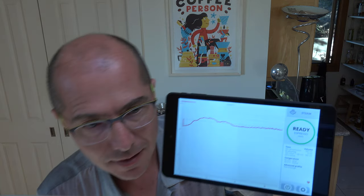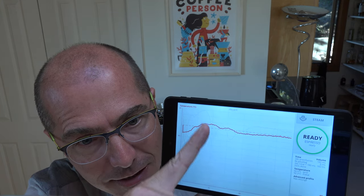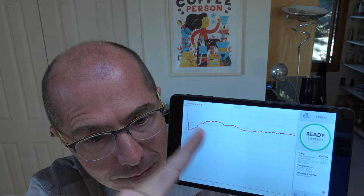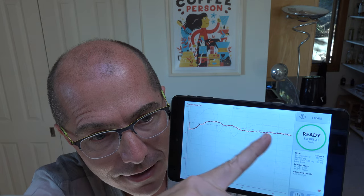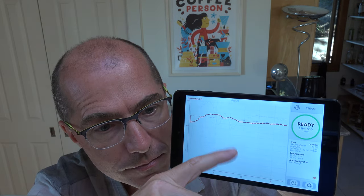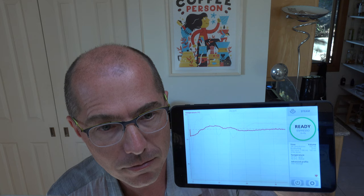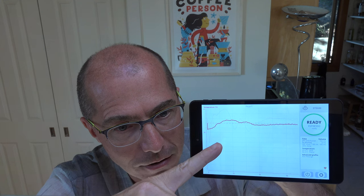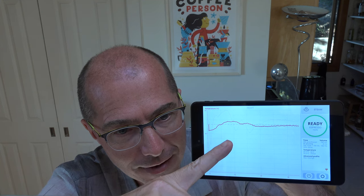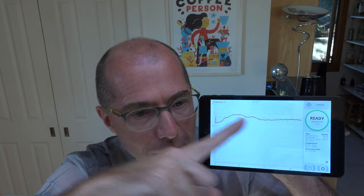Okay, I don't think you'll be able to see this here. If I change the brightness, it'll clear the chart. There we go. Can you see the thin line? You can see the thin line does adjust. It goes about 2 Celsius up from our goal temperature at about 10 seconds, and then from 10 seconds on, it's oscillating within 1 Celsius of the goal. So the machine does not need to do much temperature adjustment. Look how crazy accurate the temperature is. We're only 1.3 Celsius under the goal at the beginning of the shot, and then within 5 seconds we're right on it, 0.75 Celsius above, and then really just perfect temperature.